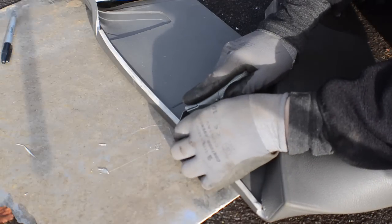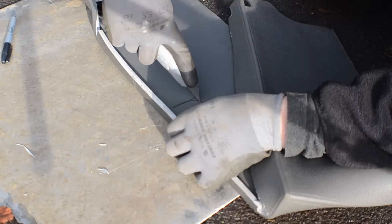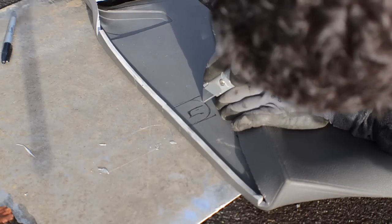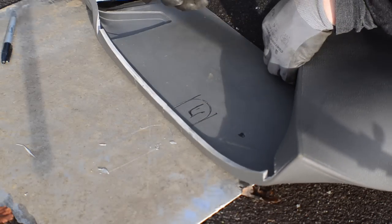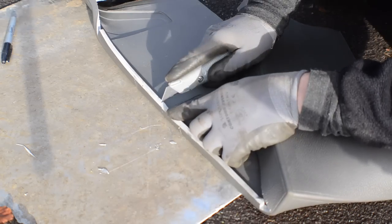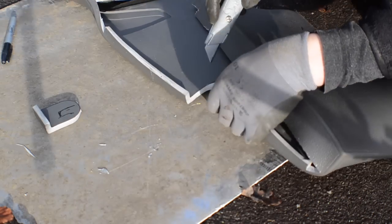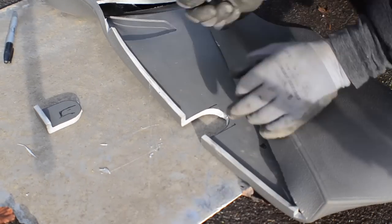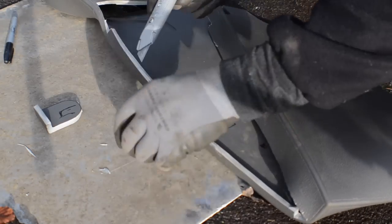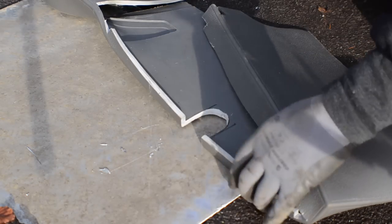I've got a new blade in, which is very important. I prefer to cut from the other side really, because you get through that hard layer first and then it tends to peel nicely — but I'm sure we can manage. Just be careful on these because where you've cut it, if there's a sharp corner and you don't handle it right when putting it in and out of the vehicle, you could end up tearing it. There we go — that's the section for our latch cut out. If you're particularly fussy, you can sand the cut edges with a fine piece of sandpaper on an electric sander to make it nice and smooth.